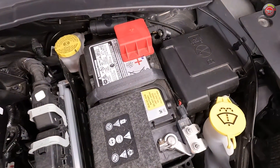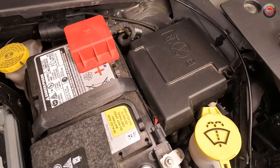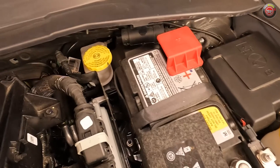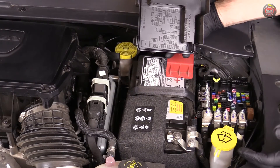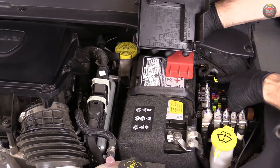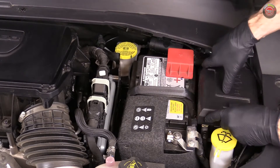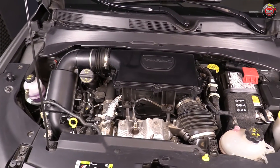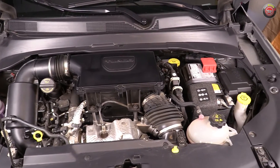The 12-volt battery is located conveniently nearby with easy access. You can see the engine ECU next to the 12-volt battery, but it's typically not user serviceable. The main fuse box is to its right and can be opened easily by popping a couple of clips — a fuse removal tool can be found inside to make it all easier. Changing the air filter does require tools and about 15 minutes of your time. We have a separate how-to video on this, link below and at the end of the video.